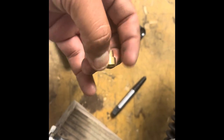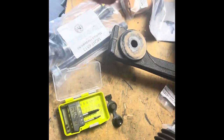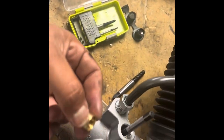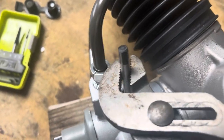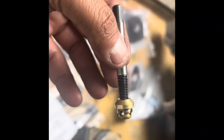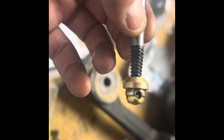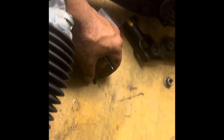I already pulled the old power steering rack out, so I took this over there. What this does is it fits in there just like that, and I made sure that the high pressure line fits in this — so this will be dropping in there. I'm pulling up because it's not really threaded, it's coming out. I took it out and it says to make sure that little ball is not left in the rack — that's what I cut the tip off for. I was worried the tip would push the ball out, so I cut that little lip off just so it'll catch the edge.